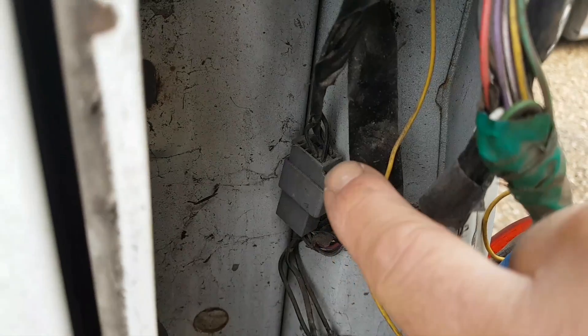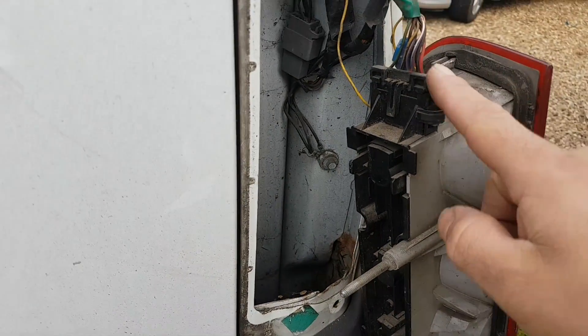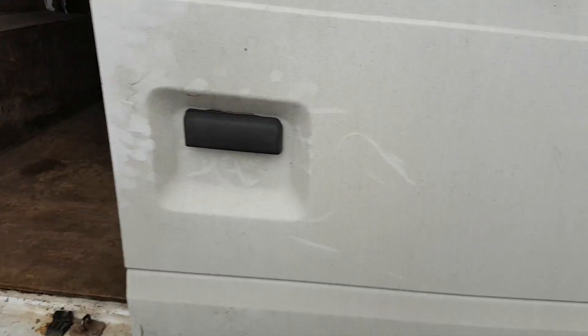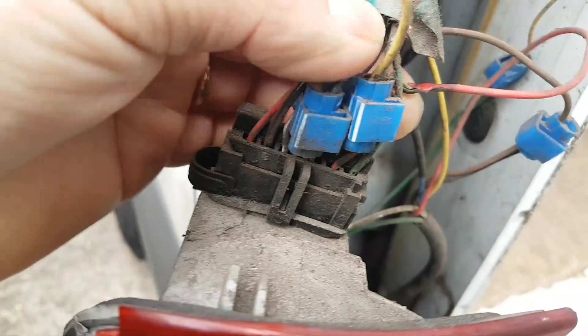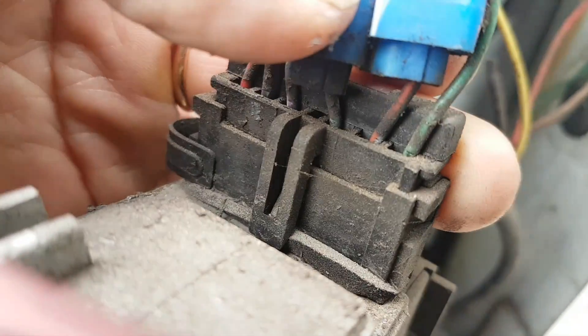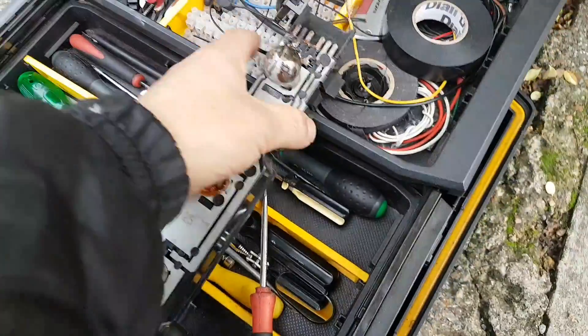You can see there's a little bit of rust on that plug in there. That plug is the one that goes inside the door, and we're going to clean the ground. There's some tape here, something has been done around here. Also there's a towbar that's been fitted, and there are crimped and broken wires here. We're going to check and make sure there are no corroded wires — and I think we've found the issue, look at this.